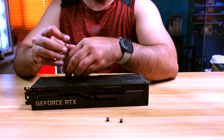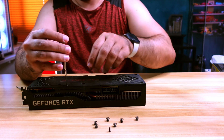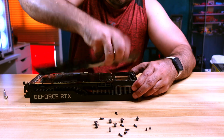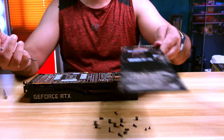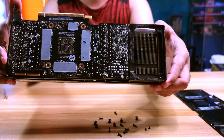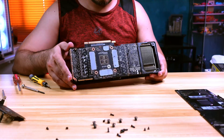Let's start by removing all the screws found on the back plate. There are a total of 6 tension screws and other normal screws. Pull the back plate gently and you can see how dirty it is. The thermal pads are also not in very good condition, but I'm not going to remove any thermal pads from this graphics card.